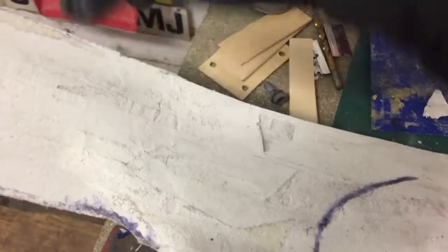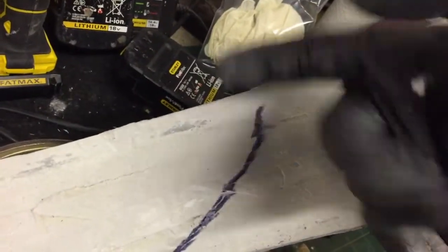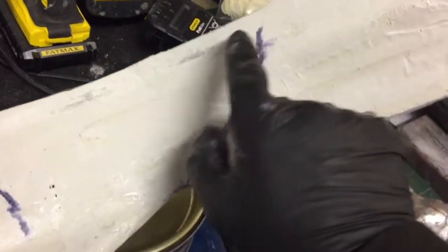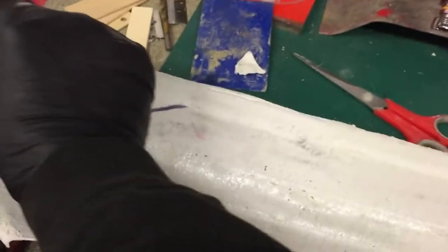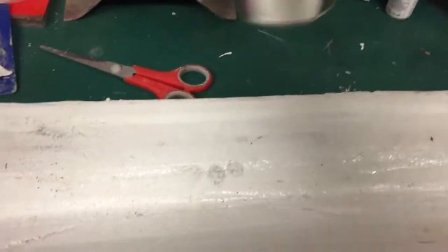So what I'm going to do is lay a bit more fiberglass on the back just to strengthen this area up through here. I also need to grind this corner back a little bit because this corner bends forward — I'm going to put a little bit more glass in there as well, just some material to actually sand back. Same on this corner here — it just kicks that way and I want it to be rounded. I'll put a bit of glass in there just to strengthen that up. I might also just do a nice layer of fiberglass along that front return — I've got a little bit of resin left which should be enough.